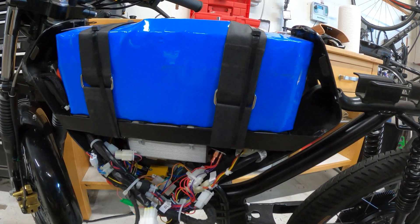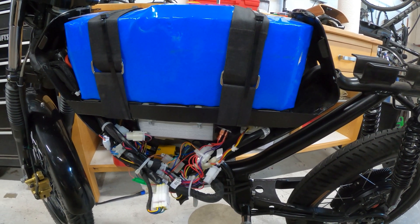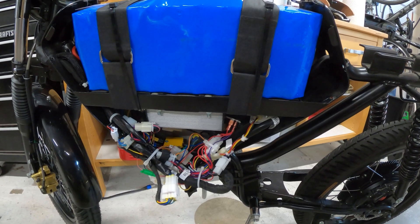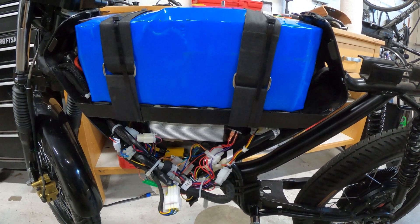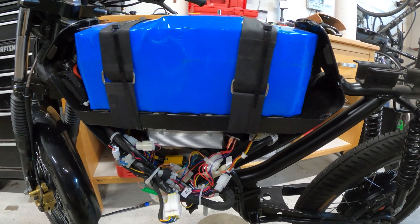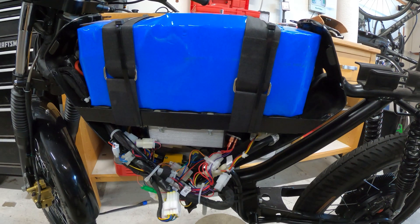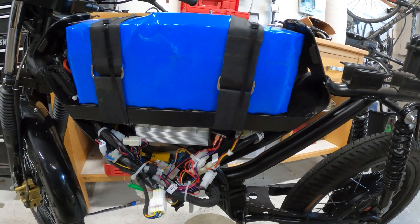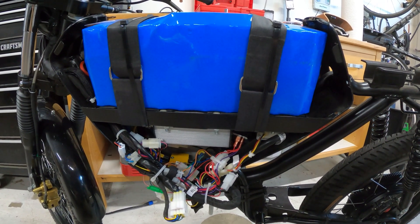A lot of people will knee-jerk do things from John Angel's blog like sicko mode and stuff, and I just want to make sure everybody's aware that those settings are pretty significant and they do change how much the controller is going to require from the battery. The formula for controller draw is that the controller peaks at 300 amps. The current setting in the AC Add User app is a percentage of that 300 amp peak. So if you take that number — let's say it's 90% like sicko mode — you're pulling 270 to 280 amps from the controller. My pack maxes out at 110 continuous, and I had some pretty high settings on there, and my pack got up to about 42°C, which is pretty darn hot.